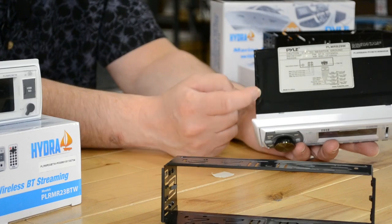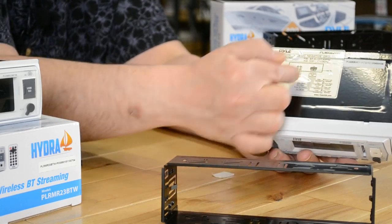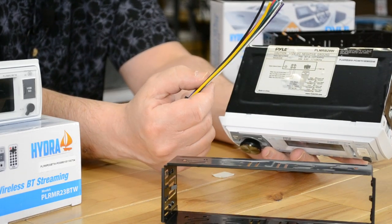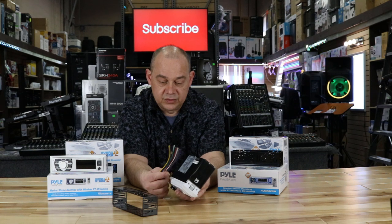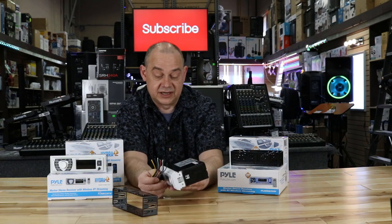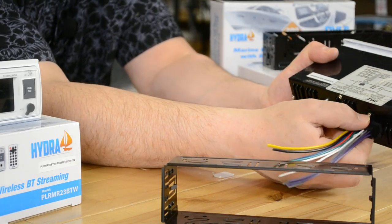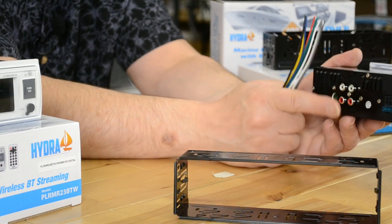Most manufacturers put a wiring diagram sticker on top of their product, which means you don't need to hold the instruction manual. The wiring diagram has stayed essentially the same for almost 50 years — we've added wires, but the basic functionality and colors have remained the same. So you can color-for-color replace one brand with another. In this model, there's no tail — you just take the harness and plug it in. The fuse is pre-installed underneath, and there are RCA plugs if you want to hook up an amplifier.